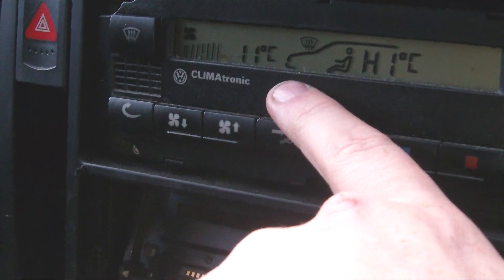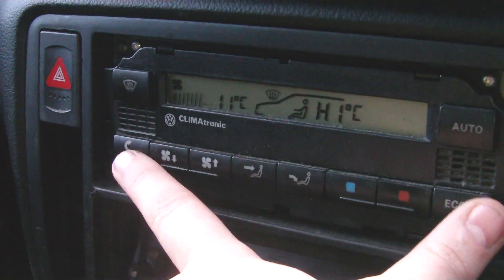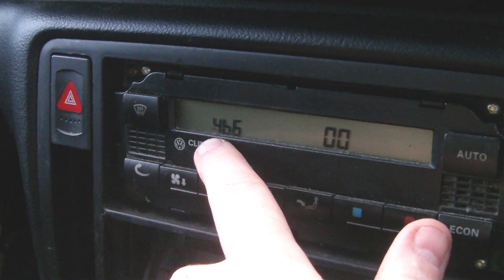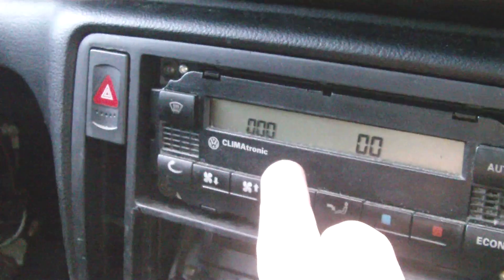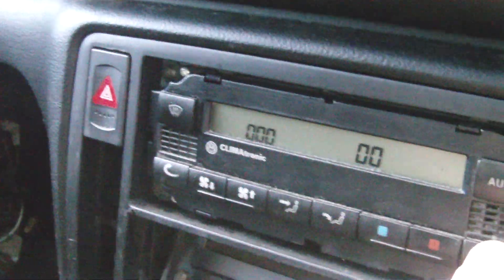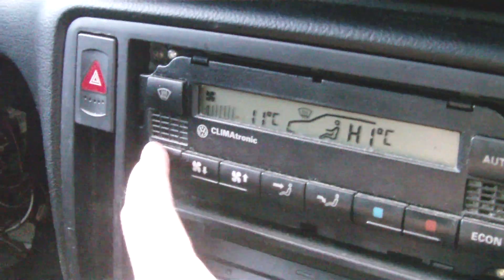Just while we're waiting — some different things you can do. If this display here flashes, it normally means you've got an error message in the Climatronic. What you do to get the diagnostic mode in the Climatronic: hold down the Econ button and the recirculation button together. It'll show the hexadecimal code for the part with the problem. You can switch through the error messages by pushing the hot button — it cycles through them all until it gets 000, which means there's no more error messages. Each number it shows is an error code. Just keep pushing that button to cycle through. When you're finished, pull the Econ button — it'll say 444, which means all the errors are cleared. Then press Econ and you're back to normal. That's how you read and reset the error codes on the Climatronic.